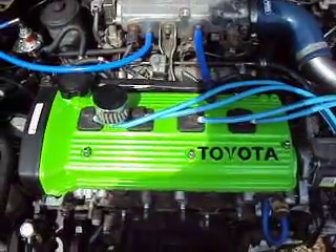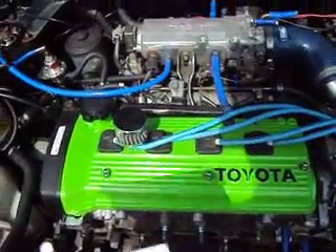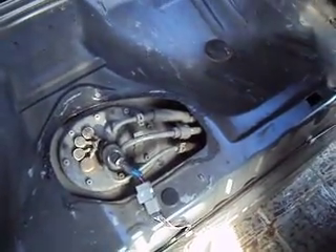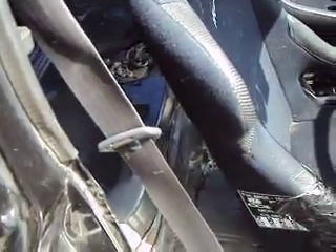Because you're putting so much boost through it now, it's probably best to change the rocker top breather as well, since the engine will breathe a lot more with the boost being run through it. It's also worth upgrading the fuel pump — I've got a Walbro fuel pump in mine, which is a direct replacement. You literally take the old one out and swap it in — about a half-hour job. That guarantees you've got a race fuel pump with constant fuel pressure. On a 15-year-old car the original fuel pump might die off when it's under full boost demand.